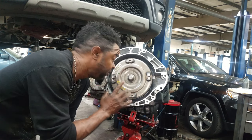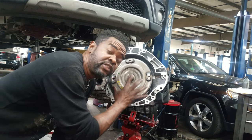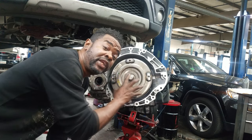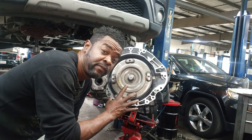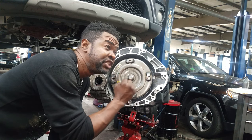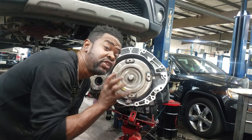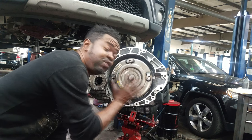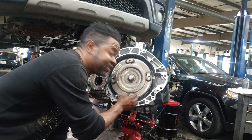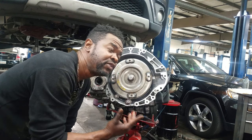Let me go over what I'm talking about, because you have to make sure the torque converter is seated all the way in the back inside the input clutch assembly. It has two gears — an input shaft and the front pump shaft. It has to clear those splines, has to set all the way back. If not, you will be fighting trying to get the torque converter to turn while you put in the torque converter bolts.